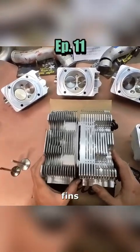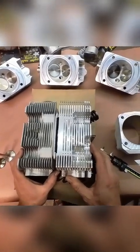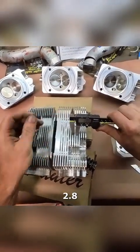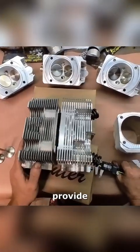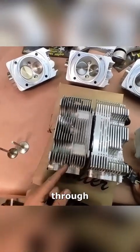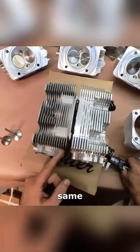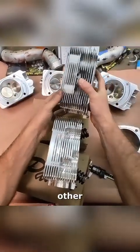Check this out — cooling fans versus cooling fins. We've got some fat, thick cooling fins here. These are 1.7, these are 2.8, so the thickness difference is massive. Does that provide more or less cooling? We've got a lot more airflow going through this cylinder head — the open area is a lot larger. We've got the same surface area because we have the same number of fins.